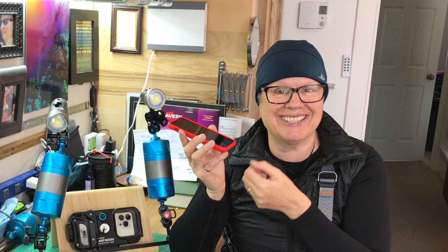Also avoid physically blowing air into any of those spaces. Don't use scuba high-pressure gas, don't use a hairdryer, don't blow anything into any openings in your smartphone — just let it dry on its own. I hope that smartphones are going to open up the world of underwater photography and videography to even more people. And who knows, as these IP ratings increase and get higher and higher, maybe sooner than later we'll just be taking this underwater.